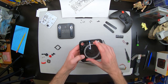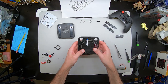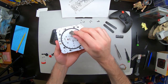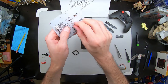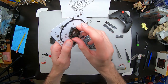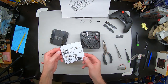Now we can slip in the rumble motor. There is a spot on the other side like they were actually thinking about putting dual rumble motors in there. Maybe for costs they decided it wasn't needed, but maybe that's something we can mod and add — because there's definitely a spot on the opposite side for an extra rumble motor. Here I'm slipping the pad back into the joystick contacts. It's got these little rubber nipples that come through to make sure it's extremely tightly held to the board and in place. And then the secure cap that holds the back side of the joystick down and holds the rubber sensor piece down too. I feel like all of that is there to make sure that the joystick is always able to press those contacts properly and very well.